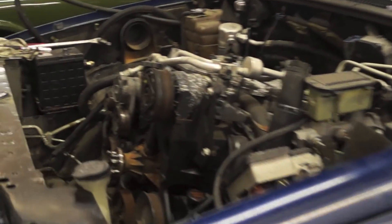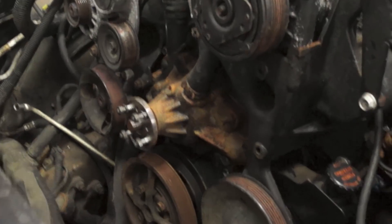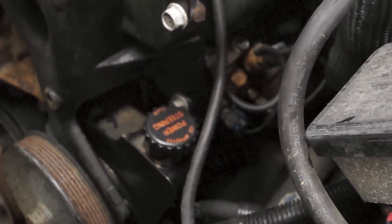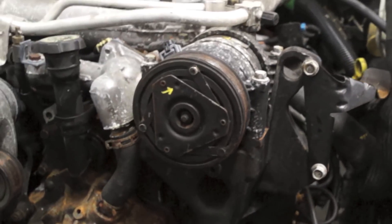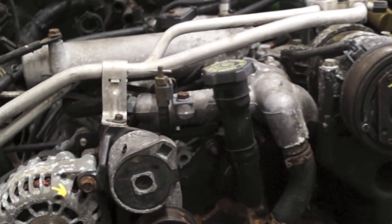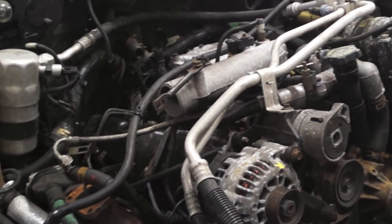We're making really good progress on getting the engine removed. We've gotten the radiator out, fan shroud out, all that stuff off and disconnected. One tip I have for you guys when you're doing these projects is to go ahead and identify the sensors that you're going to need — like for instance this one right here is for the water temperature. Identify the sensors you're going to need to transfer over to the other engine: the water temperature, the oil pressure, the tachometer — all of that stuff — before you completely remove the engine out of the vehicle. That way it makes it easier to transfer the sensors over to the Cummins.